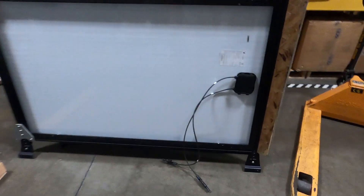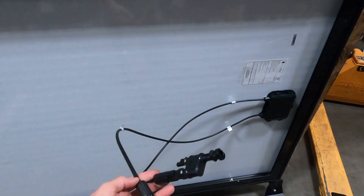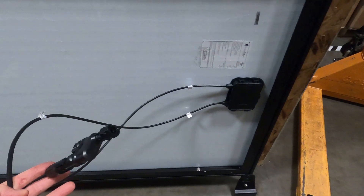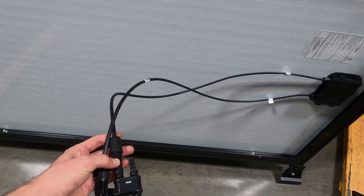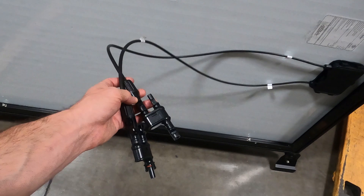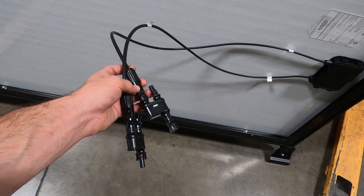Here's the plan: I'm going to take the panels and actually use a forklift to put them on top of the van since I have access to one. I'm going to use parallel connectors to connect the two panels in parallel, then feed two wires — one positive, one negative — through the roof of the van and into the charge controller.